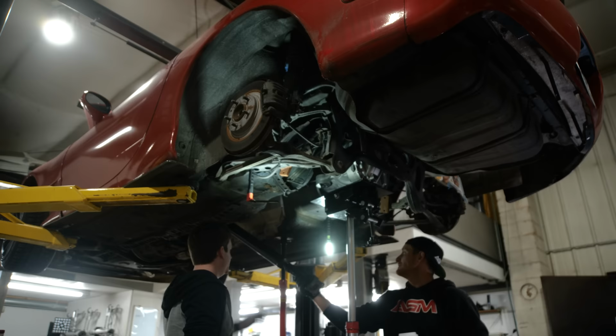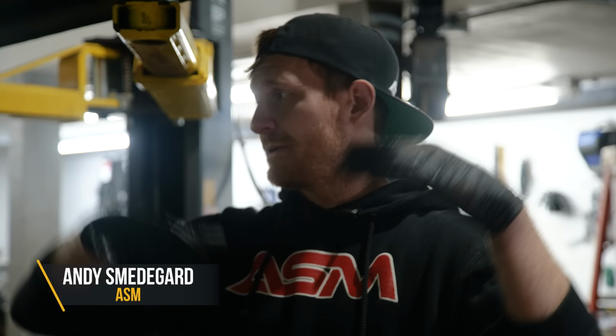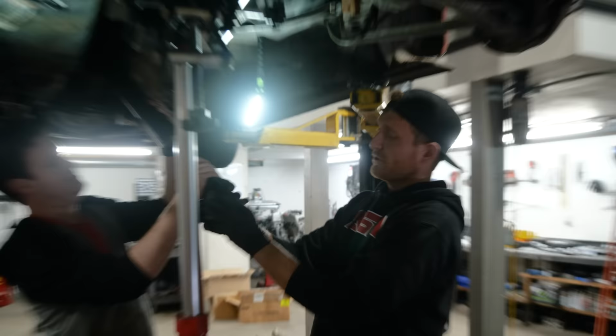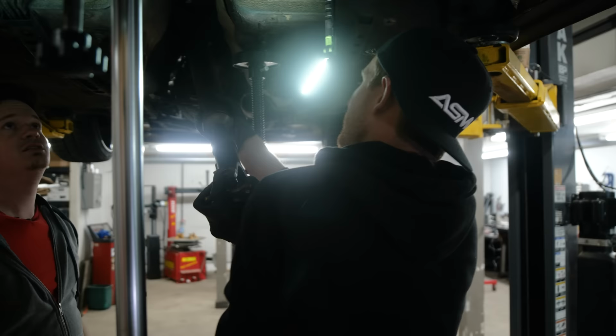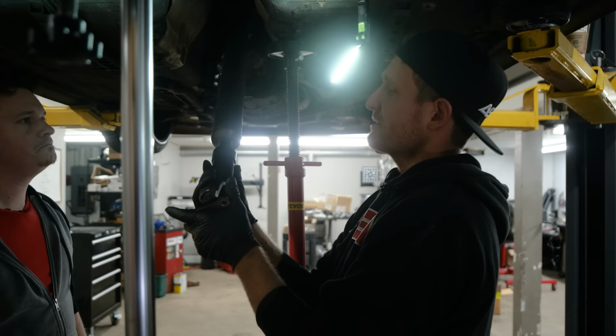With the drive shaft, there has to be some sort of slip in the drive shaft because it's gotta move in and out, depending on suspension travel and everything. The diff moves, so you have not only your U-joint that rotates in almost any direction, you have to have some in and out. And in this case, this is the one we made for the S2 trans with the RX7 diff, made by Full Torque Solutions. And it's what they call, I think, a slip yoke. But basically there's a spline shaft.